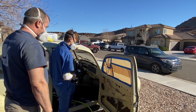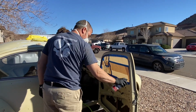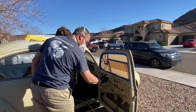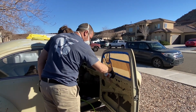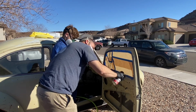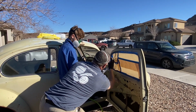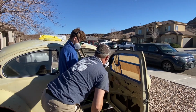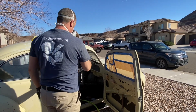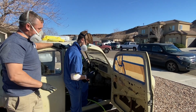It's too thick. I don't know. I'm scared. So watch this. I'm going to do this right here. I start kind of off the car. See? It's just doing that. And then see how light it is right here? I need to get up on top of it a little bit too. And then I want to get up in here, and then up at the top. See how it just keeps feathering on, just a little light dusting? That's all you're doing. Don't be scared. It's just paint. It's not supposed to look perfect. Yeah, this pass isn't perfect.